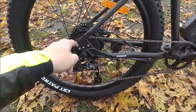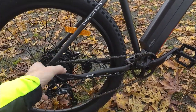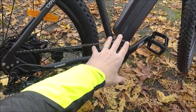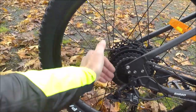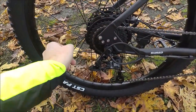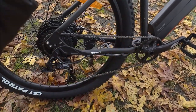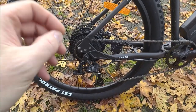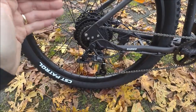Since the motor is turning the wheel, the riding sensation feels a little bit zippier than with a mid-drive — the rear wheel is pushing you along. On a regular bike, you propel the bike by turning the chain, which is what a mid-drive motor does. But the big thing is that when I change gears — and we've got a SRAM X5 on the back with lots of gears and a pretty good climbing gear — that only impacts your pedaling. It has no impact on the motor because the motor is turning the wheel at the same circumference. Whereas with a mid-drive motor, when you change gears, the motor is also in an easier gear, helping you climb hills. A mid-drive motor is going to give you more advantage for climbing hills and a little bit more torque. But for the price point we're getting this bike at, that's one of the compromises that in most cases works.